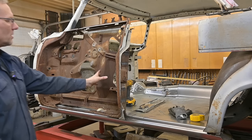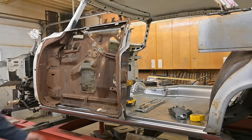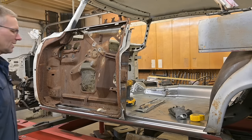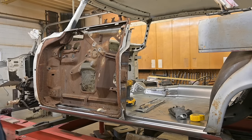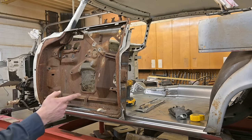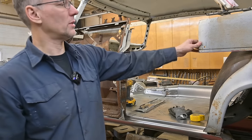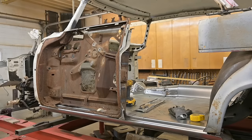This door will just add material in this area. The original window stop will retain that, and we'll create a new bottom of the door because things are kind of deteriorated there. They had drain holes, so I'm not quite sure why this went as badly as it did. There's a little vent here — not sure what that's about. We're going to get one side roughed in, get that post located, and get the web in. Then I think we're going to blow everything out, prime all the panels, reassemble it, and move on to the back of the car. This is separate from the roof section, and then we'll fill in more blanks as we move forward.